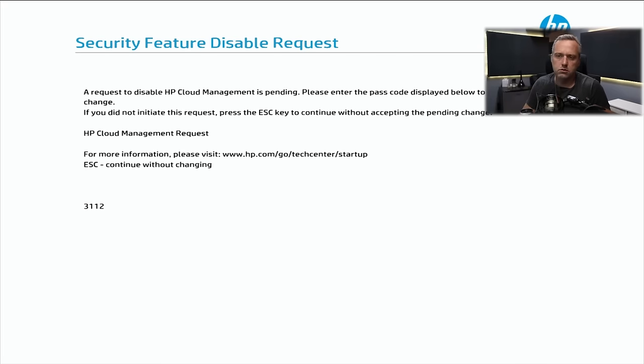Resizable BAR needs to be disabled for virtualization. I don't think it really matters much for us since we're going to be basically passing it through. I've had issues with resizable BAR in the past, flipping back and forth. If you have resizable BAR disabled, make sure it's disabled in your hypervisor. If you have it enabled, make sure it's enabled in your hypervisor — that's the gist of it.